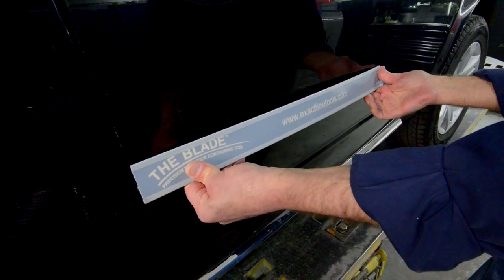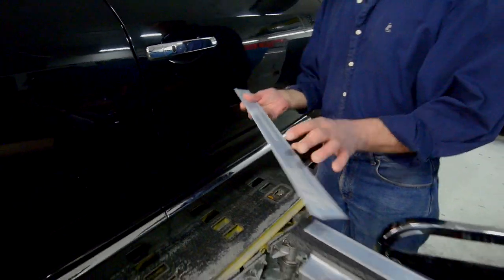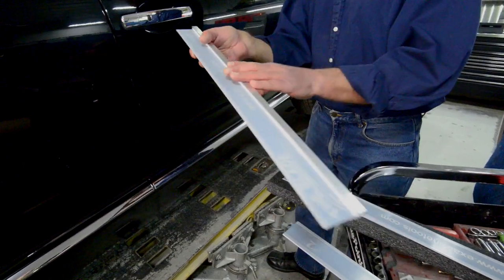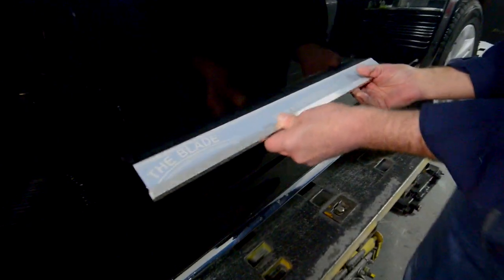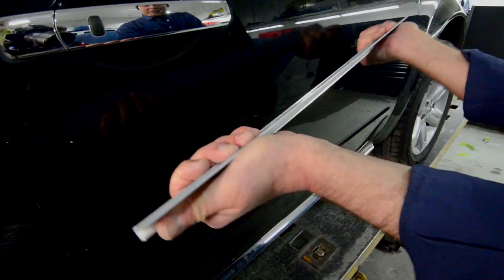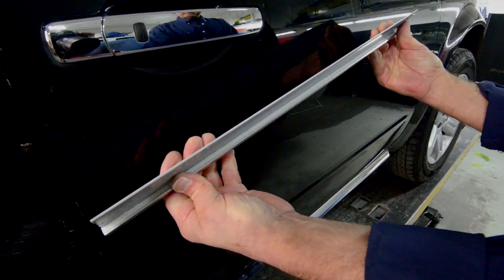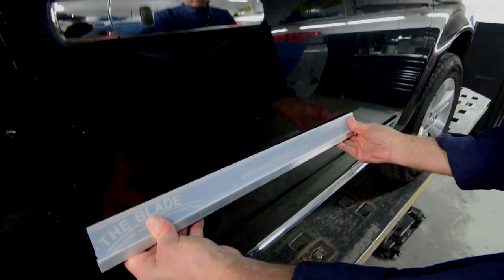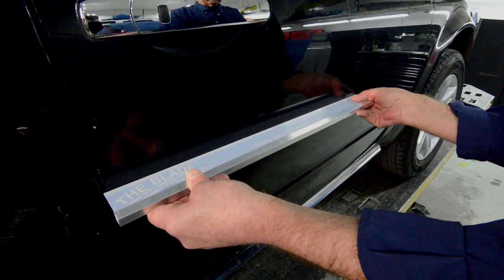In which case, we will use any one of the blades. I prefer the number two blade with a stiffener on it, which makes it a rigid blade — flat — and even at a steep angle like this, it cannot flex. It's absolutely rigid. So the working range for this blade is only a flat blade. I could transition down this panel with this blade and it's going to keep this panel absolutely flat.